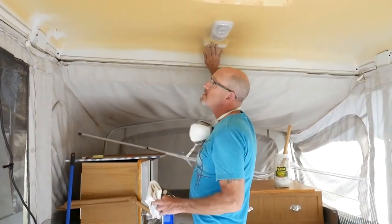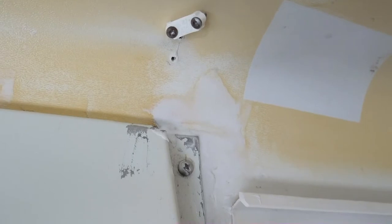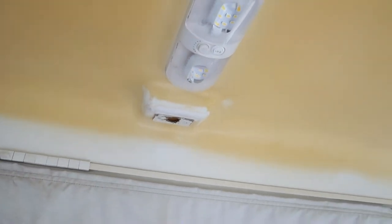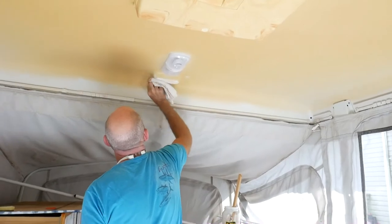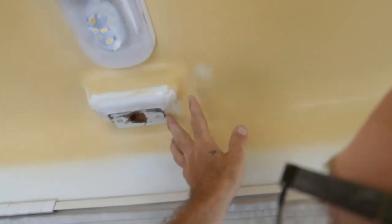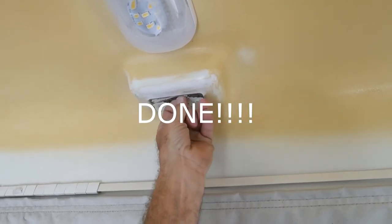As you can see with the initial ABS repair on the cracks, got them all sanded down. I'm going to be wiping them down with some MEK, cleaning them off, and adding a thin coat of our ABS mixture to some areas to help fill the cracks better. I've got a putty knife to do it with this time instead of cardboard — when you want to do something and forget stuff, you improvise. Nice and smooth — no divots. Once we paint it you won't be able to see that crack anymore, and it's solid as a rock.